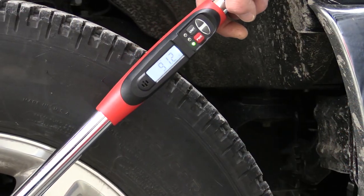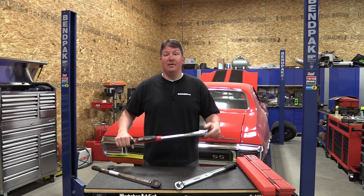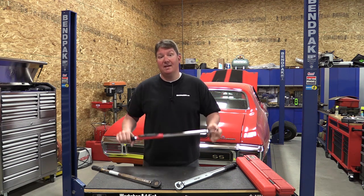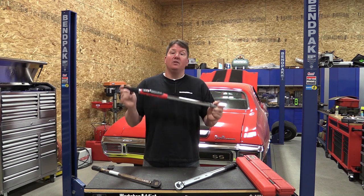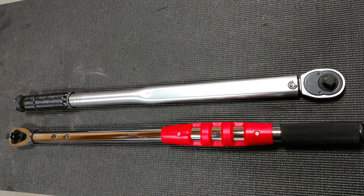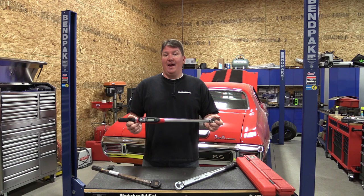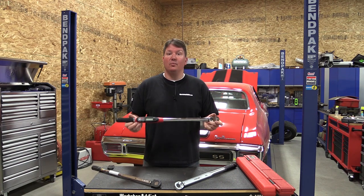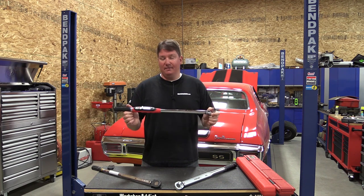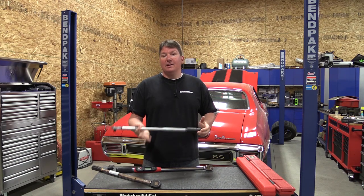The digital is great for working on engines — if you want to hit 33 foot-pounds, you can watch the gauge build up. It also shows the actual torque applied, so if you set it to 90 foot-pounds but applied 110, you can catch that. Cool features, but more dollars. Don't ever drop it — lots of plastic and it takes batteries. A lot of people gravitate to digital because it's cool technology, but it's not ideal for the every-weekend DIYer who isn't working on motors or valve trains.